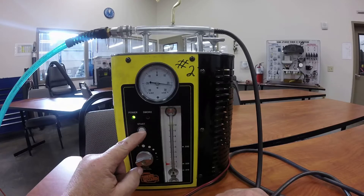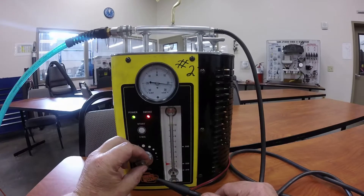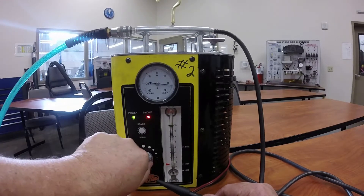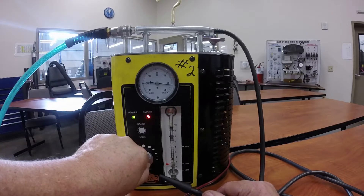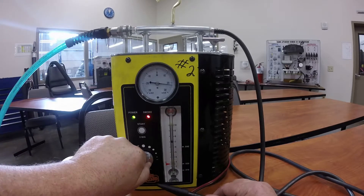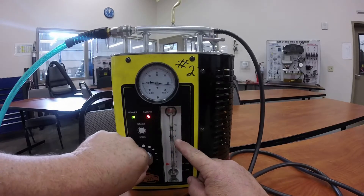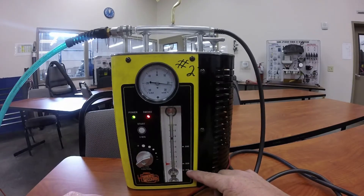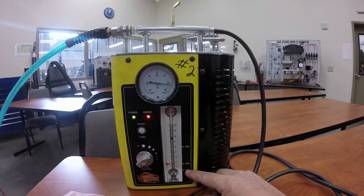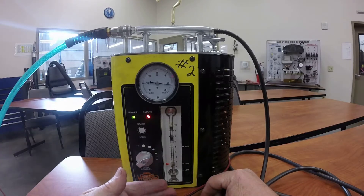The smoke light will turn red when you push the start button. We've got a red light that came on here, and this is your flow regulator. You can see the little ball that goes up and down — you can adjust how high it goes. This also has settings for evap: 10 thousandths, 20 thousandths, and 40 thousandths.